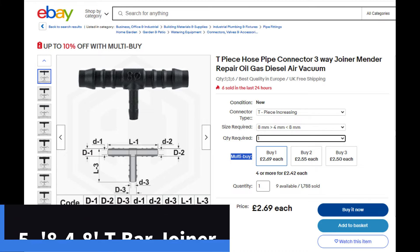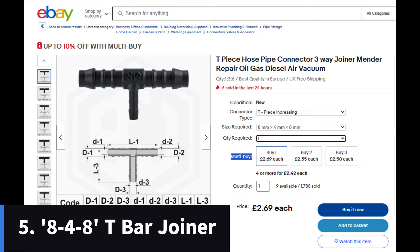An important thing to note on your shopping list: you will need an 848 T-bar reducer. This basically manages where you'll connect your vacuum hoses on your new 1ZZ manifold. The 4ZZ and 3ZZ have three ports for the vacuum pipes, and when you add the 1ZZ manifold you're going to have an extra pipe. Some people leave it blank, but the car will run terribly and you won't get the proper performance. This T-joiner lets you run the 4mm piece of pipe from the top of your intake manifold into it, so everything runs as it should.